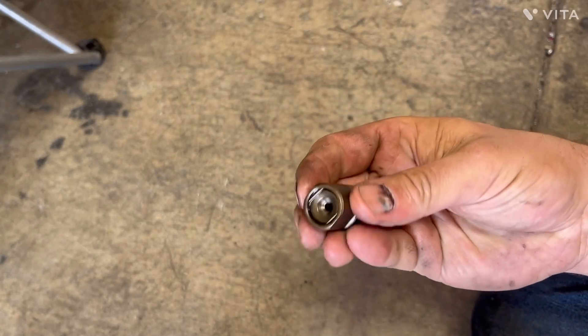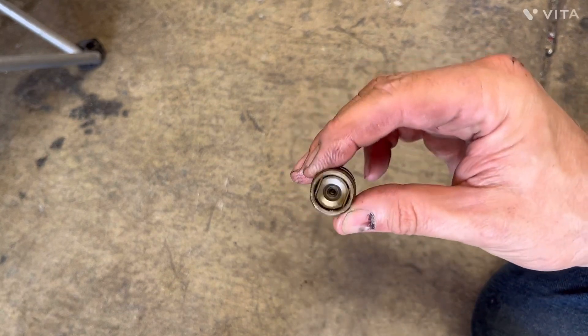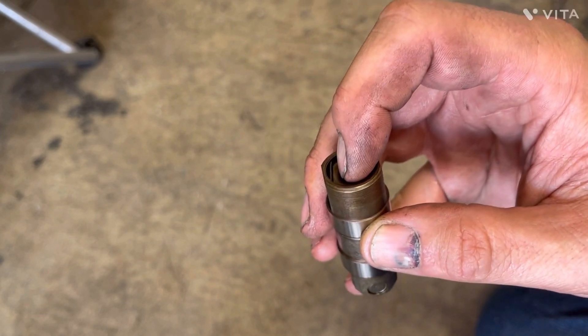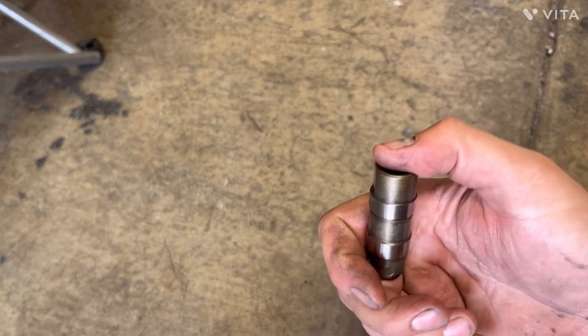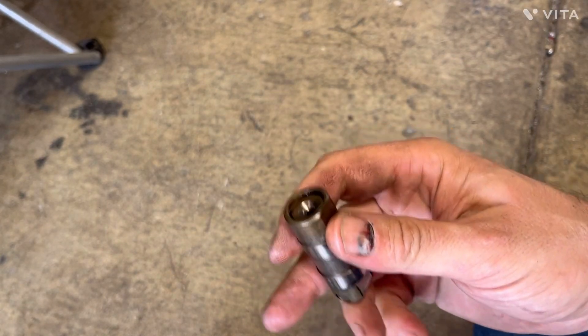I'm doing this with a magnetic dial indicator on top of the valve stem. The issue is that the stock five-liter HO Mustang motors use a hydraulic roller cam — you can't turn the motor over with hydraulic lifters without the lifters bleeding down, especially with a lot of open spring pressure. The lifters will bleed down on the first revolution, so there are two ways to handle it.